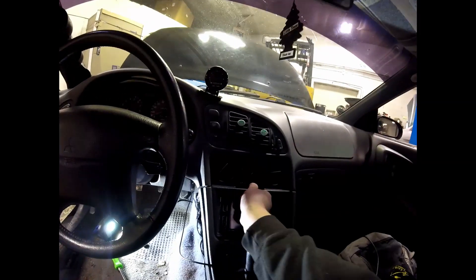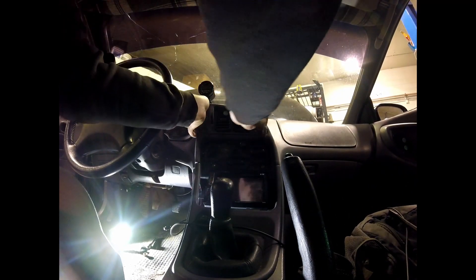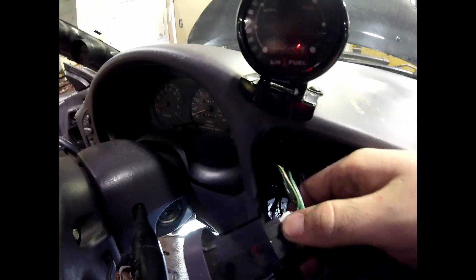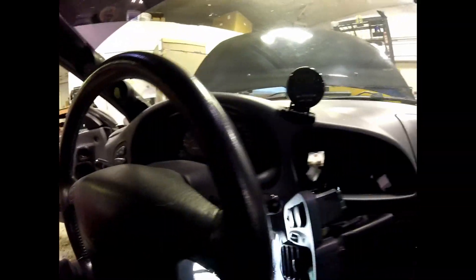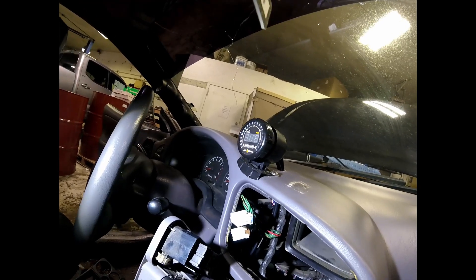And this is where my harness for the Innovate plugs into the O2 or the sensor part of the harness. Undo that - I'm going to have to kind of rerun the new wires. As for the gauge, the way I did mine - like I said, it sits right here. So to get this center piece off, kind of just pull on it - pops out. And then for the top, push the vents up, stick your fingers in there. This is a 95, I don't know what the later years necessarily look like back here. They're all probably going to have this rear wiper plug for the motor and switch. Pop that one out, and then for your alarm and hazards and stuff here on the left side. You can see back in here those little pigtails back there hanging down on my gauge. I'm going to go ahead and probably unplug them from the back of the gauge and then pull them down through the dash.